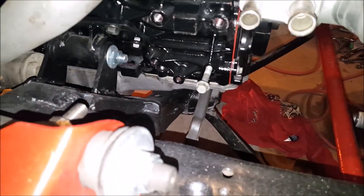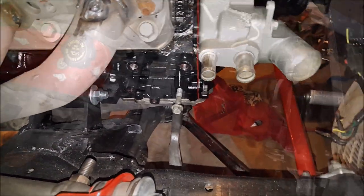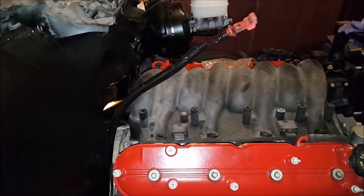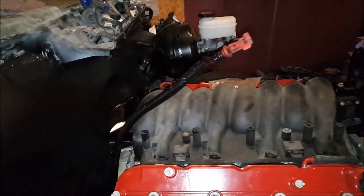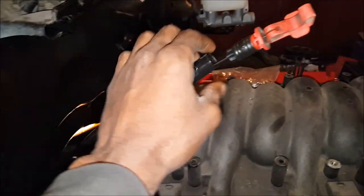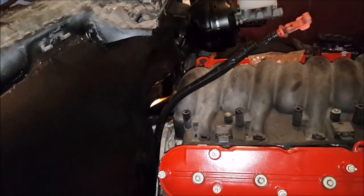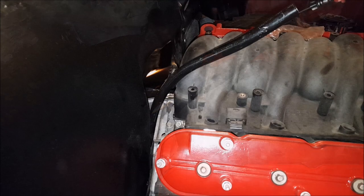Sent my AC compressor bracket to my homeboy — he's welding it. It's gotta be moved back a half inch so the truck AC compressor lines up. Once that's done I'll have that bolted up and start running the AC lines. The dipstick is too tall — it's made for the truck so it's gotta come out of there. What I'm gonna do is cut it down, cut the wider section off, weld it back together, then cut the dipstick itself and get that precise. I'll have that done by the next video.